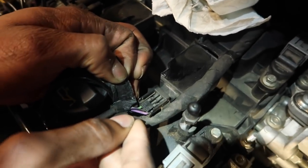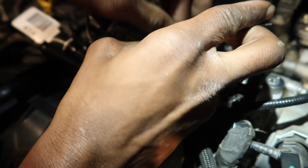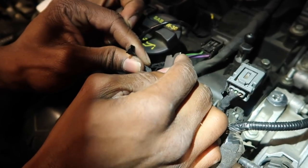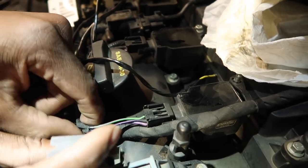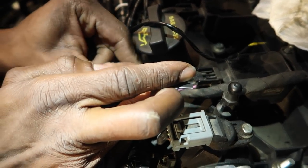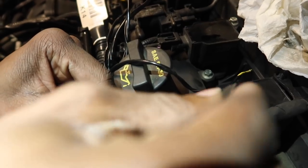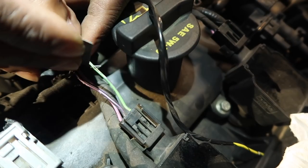So the wire that we need to get to is going to be the far left one in each connector. Cut back the tape on the sheathing — you can use a razor blade, just be very careful. You don't want to touch two splice wires together even though there's no power signal going through it. The wire we need is each far left wire in each connector. We're going to splice into it — you don't want to do it too close to the connector just in case you mess up, so do it a little bit back. As long as you have a sharp blade, the sheathing should come off fine and you'll expose the wire.